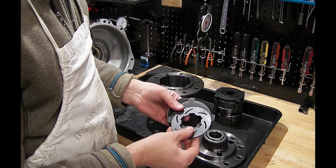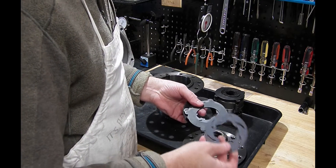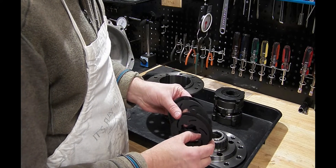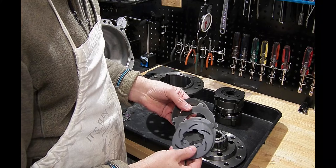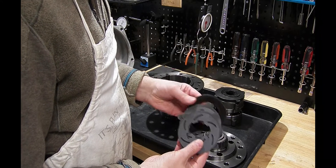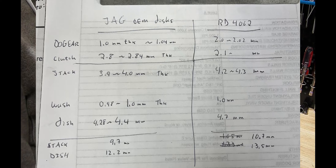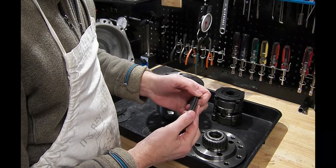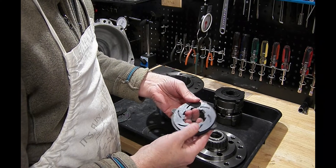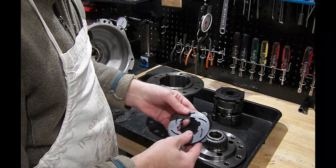These friction discs are much better. They're made from a molybdenum ceramic and they're very durable, and even the stationary discs feel much more substantial. I'm really looking forward to this. The rebuild kit is about 6 to 8 percent thicker than the discs that we're replacing, which were worn. That's a typical number you can count on — new materials, new discs will be a little bit thicker than the old worn ones.